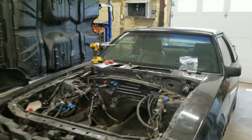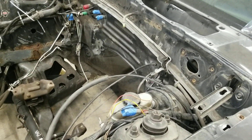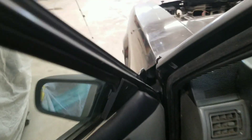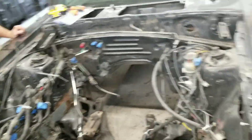Alright guys, we got the hood off — that was four 10-millimeter bolts. The fender bolts, I believe there are five of them, and they're all 8-millimeters. We just unhook this bracket here on both sides and everything is loose. There is a bolt in here you've got to use an extension to get to. On this car we had to remove the ground effects — it's all Phillips screws, supposed to be about six or eight per side. This one only had a couple holding it on, but we'll put some extra ones back for him when we're done.